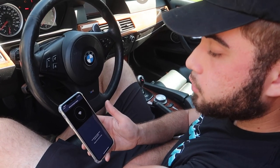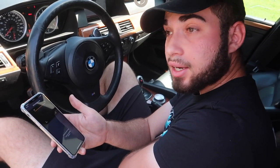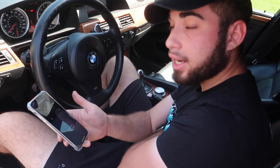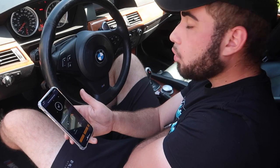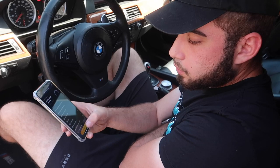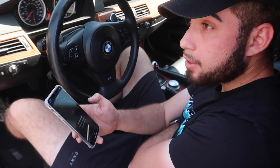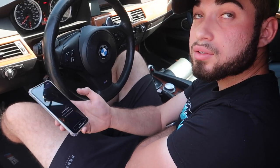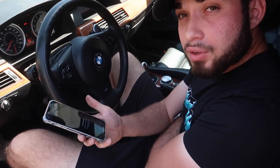We gave it about five cranks — the exhaust kicks in and it sounds like the car starts, then it cuts off again. I don't know if it could be a battery issue or something else. These cars are really finicky and one little thing can cause them not to start. Let's run the codes again and see if we got anything new or if we still have that crankshaft sensor code — maybe it's not even the crankshaft sensor, maybe it's flagging because of something else. I might call up my boy Nick to help run the codes.